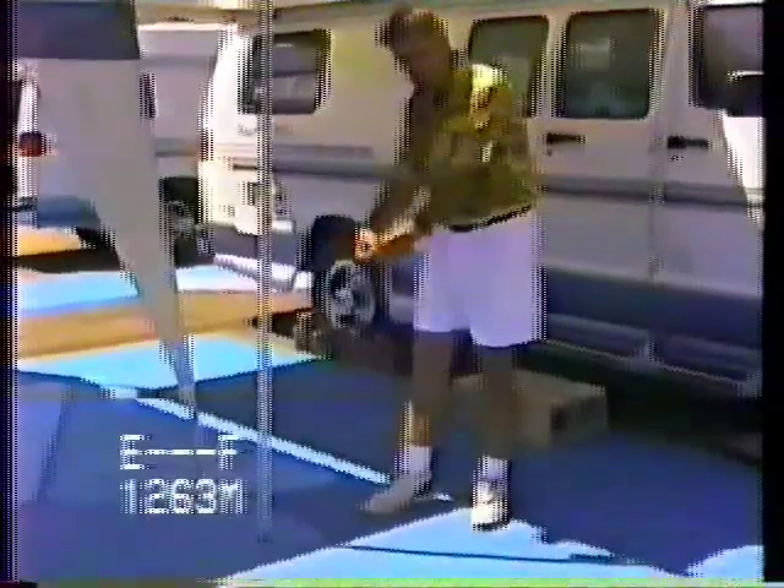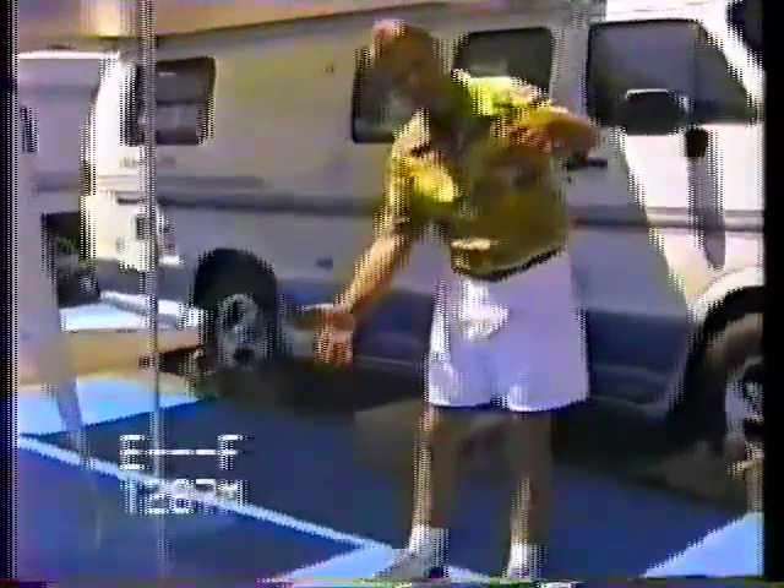In the bottom of these little feet there are holes, and there are some stakes inside the accessory drawer. If you're in a grass area, stick the stakes in at an angle on either side to hold them in. The best thing is to get an awning tie-down strap — it's a big corkscrew that screws into the ground with a strap that goes over it. In the afternoon the wind is going to come up — this is a sail. When it goes up and over your motorhome, this $700 awning is going to cost $600 to repair. So it's really important.